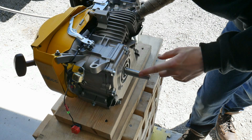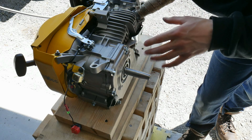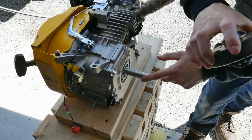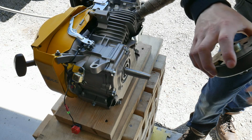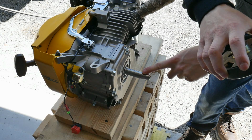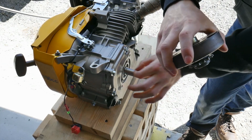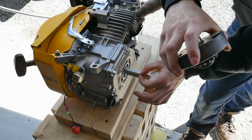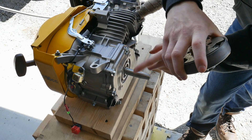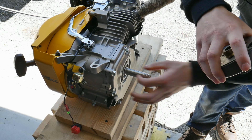Basically this is a tapered shaft pulled out of a pressure washer — this engine actually came out of a pressure washer. We have our three and a quarter inch clutch here, which is a seven-eighths inch shaft diameter. What we're going to do is take the angle grinder and grind down the shaft to accommodate the clutch, and then take a Dremel precision cutting tool to grind out a notch in the shaft for the key to be inserted, so that the clutch can slide right on and not move anywhere.